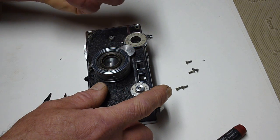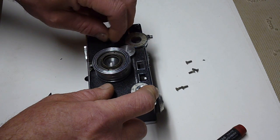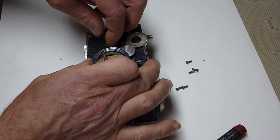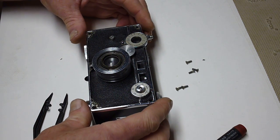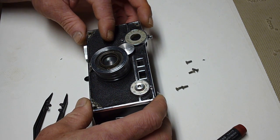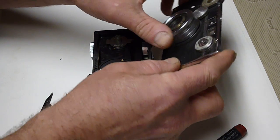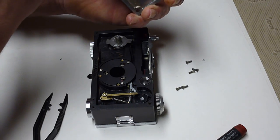Most of these vary a little bit. This one is screwed on. To get it off, you undo a little set screw back here — you loosen that up, you don't have to take it off — and you unscrew it counter-clockwise. Now when you take the face off, you want to pick it up a little bit high on the top edge to clear the shutter cocking lever arm, then slide it forward like that.